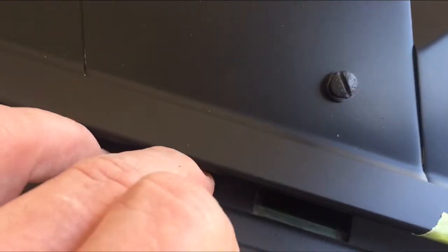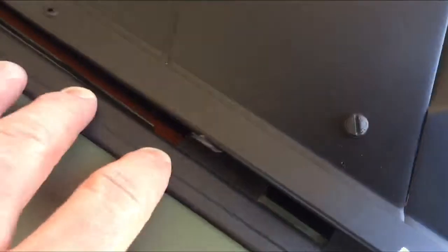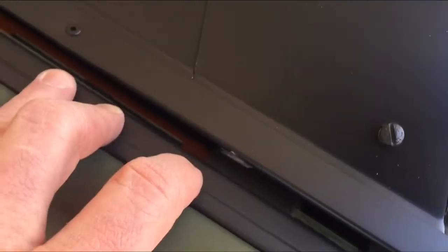But I gotta watch I don't put too much pressure on these taped brackets, because I don't want them popping off either. So I'm gonna take the louver off now, leave the brackets where they are. I'm gonna mark them up, and I'm gonna tape those down, let that bracket sit for 24 hours again, just because there's gonna be a lot of force on those, and I don't want them popping off prematurely. I've already in advance cleaned the window with alcohol, so that way any lines I draw with my grease pencil should not get erased, and we'll see how that goes, and we'll come back at you.